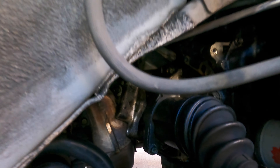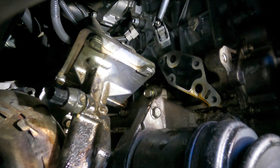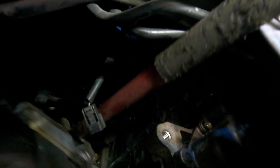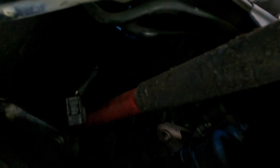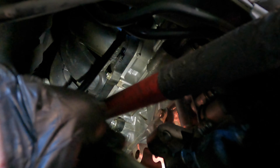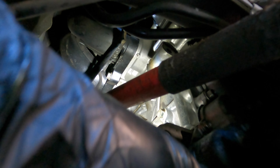After taking off all the hoses, what I do is use a little bar, go along there, hit and push behind the hose so it will come loose. Push behind the hose and it can come up - makes it easier without pushing very hard. It's really no room at all, you know - it's hard. I need the light as well, not just for the camera but for myself.